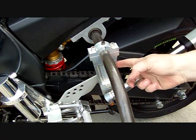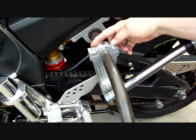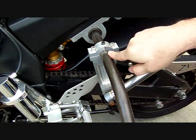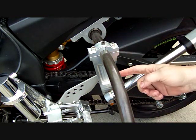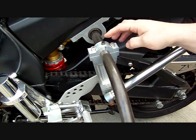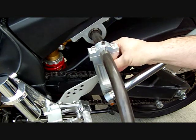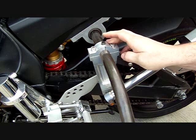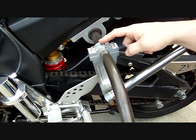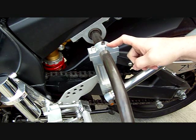One other thing to point out with this aluminum arm here is originally I just had this clamped on, and it worked okay until one time this bar basically slipped through here. Most of the other setups I see just have a metal tab welded on. This one we clamped on, but I've got a bolt through it now, threaded through this and this, so it can't actually slip, which I should have done in the first place. So if you use a clamp on arm, make sure you put a dowel pin or a bolt so it won't slip.